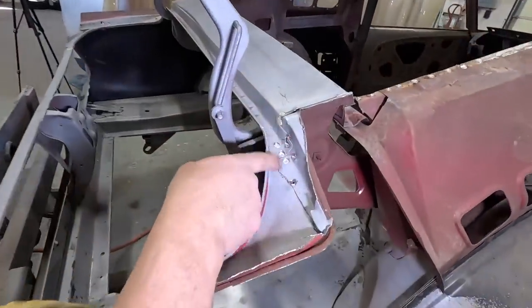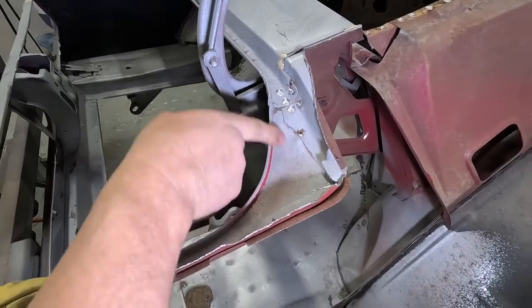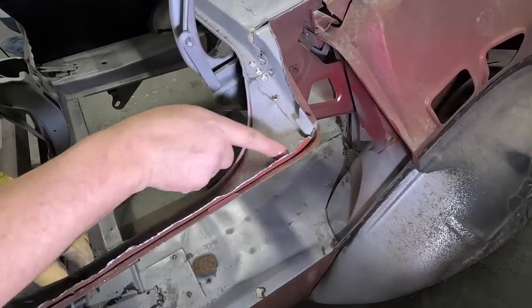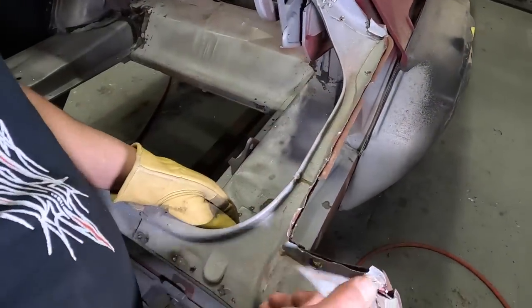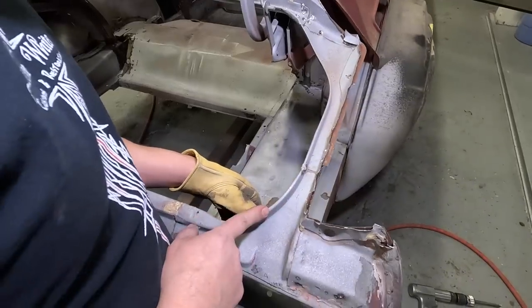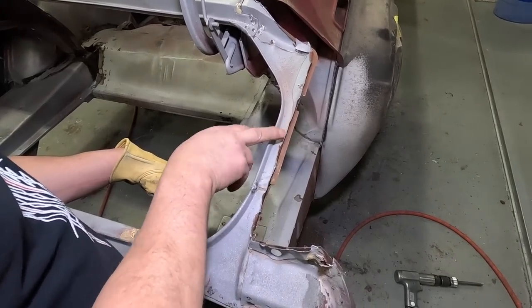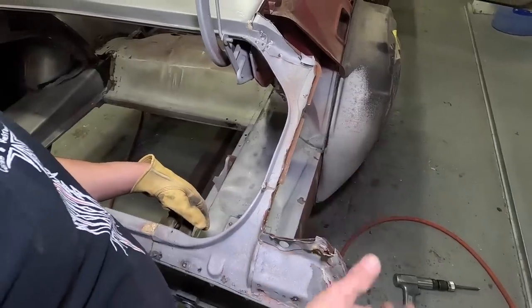These you have to go in and hand chisel and be careful. You don't really want to use the air chisel on them and damage this panel or this panel. What are you trying to take off here? This whole little corner right here. And of course this little piece right through here where I've drilled the welds. That's delicate too. These are delicate because you don't want to damage this panel right here, your lip of your trunk. If you damage that, then it'll move and it'll throw your measurements off or your lineup points. So you want to be careful with these. You can take pliers, and all this has to be removed by hand. You can't use the air chisel on it.